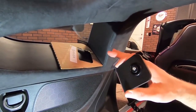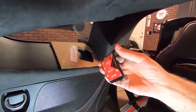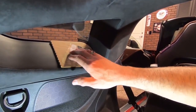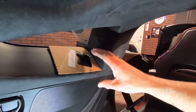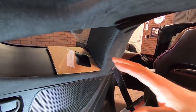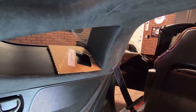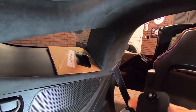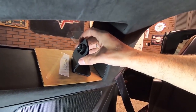Once the primer is dry, we've pre-started peeling back the tape on the bracket. We're going to set this bracket inside the hole and press it down. Now, the folks at Wind Restrictor told me this is kind of an optical illusion — everyone thinks it isn't going on straight, but if you look at the instructions it shows it goes on at an angle. Just trust the template and don't freak out. Make sure the nut that holds the restrictor on is facing to the back, then put it right in the hole.